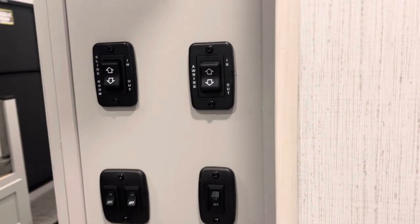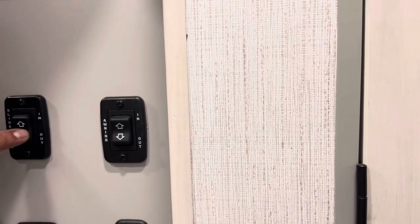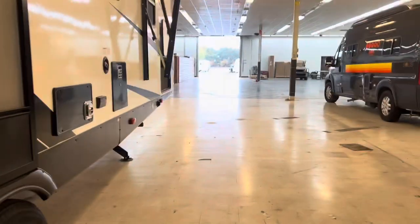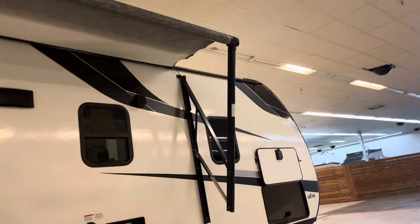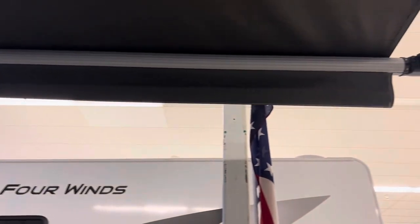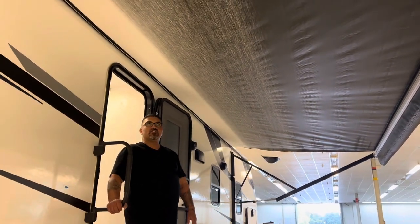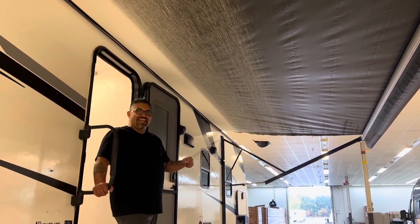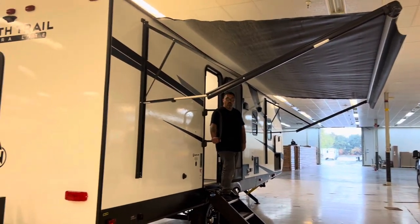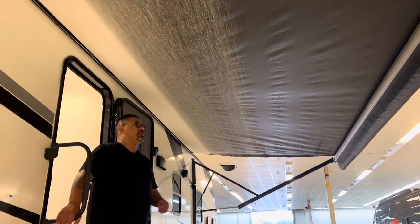Next, we're going to pull out the awning. Make sure you are clear of any trees, it's not windy, and it's not pouring rain, as those conditions can damage the awning. Next to the slide out button, you'll see the awning button — same concept, in and out. Hold the button down until the awning fully extends and the flap comes down. Once the flap comes down, that's as far as it goes. If the flap doesn't come down, stop at the metal cylinder — the flap can get stuck from moisture. Do not leave the awning out unattended; a gust of wind or rain can damage it. Always be aware of weather conditions. To close, push the awning in button and hold it down until the awning completely closes by itself.